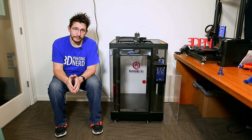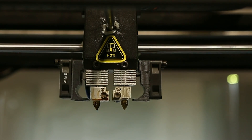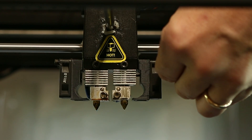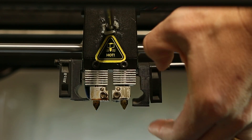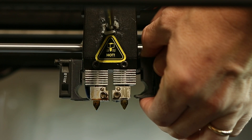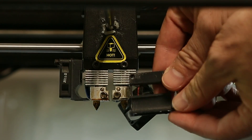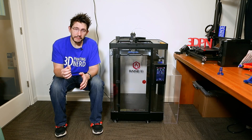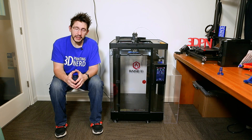Now let's talk about some things I don't like. The fan that blows across the throat of the extruders is also the same fan that blows air down onto your 3D printed parts, meaning you have no control over that fan speed. If you're printing ABS, you'd normally want to turn off the fan blowing down onto your parts — but you can't, because you can't turn off the fan cooling the extruder throat. RAISE3D gives you two small clips to fit over the fan shroud to block most of the air, and it does work, but it feels cheap and doesn't belong on a printer of this caliber. A printer like this should have fans that are controllable by the slicing software.